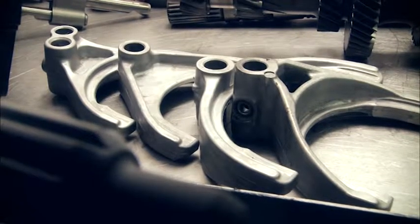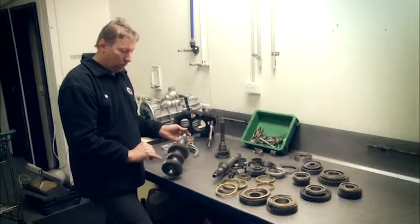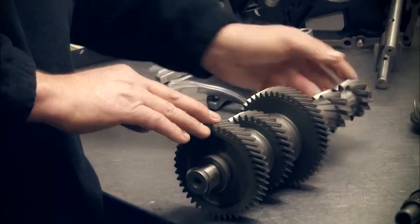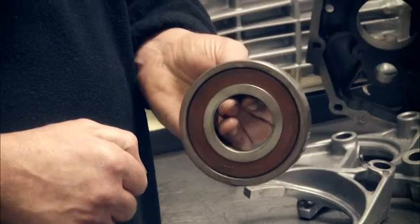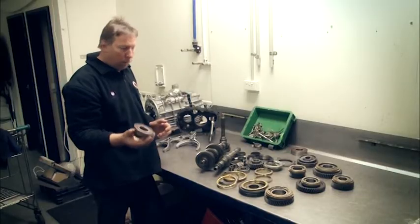The forks — we'll check for clearances. We're visually checking the cluster, looking for signs of wear and tear and it going through the hardening. Once it's gone through the hardening, there'll be a lot of noise coming off the gear — we won't use this. Same with the bearings: a quality rebuilder will not reuse bearings. All the bearings will get thrown in the bin.